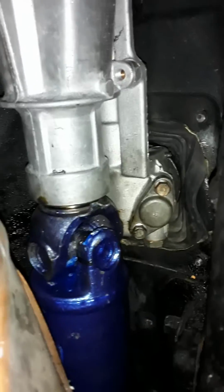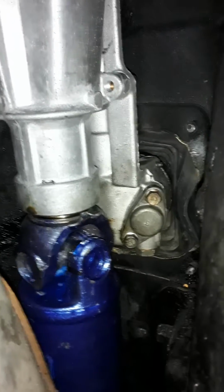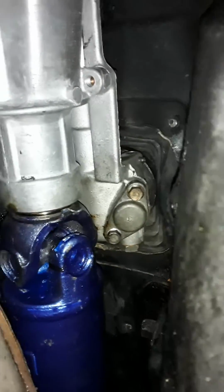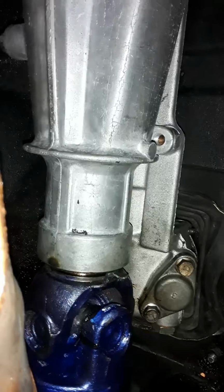And the reason why this is leaking, because that crush washer is destroyed in that rear diff, when you actually accelerate forward, it's pushing this into the drive shaft, binding up the whole gear case, and then when you go in reverse, it's actually sucking this back out into the diff. So that's why that's leaking. Other than that, everything else seems pretty good.